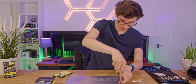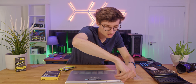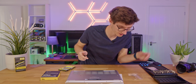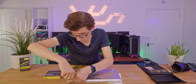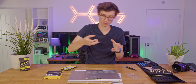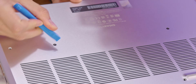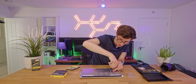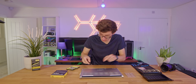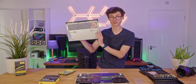It's very straightforward — I'll just take out all of the screws on the back panel. It's worth noting that sometimes some of the screws are longer than others, so please do make sure you remember which screws go where. You might be wondering why they use star-headed screws — I think it's just that they don't want people opening up laptops who haven't prepared for it, which just reduces the risk of anything breaking. You do have to be careful because sometimes there are hidden screws underneath — these might be because of warranty and were actually covered up with a little bit of black material. So I've just scratched that off, and then we have two more screws to remove. Do the whole thing very gently — if it isn't coming off and you've got some resistance, there's probably a screw you've missed.